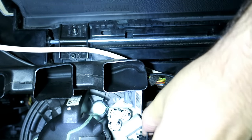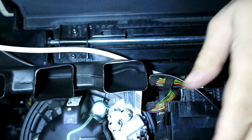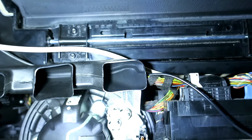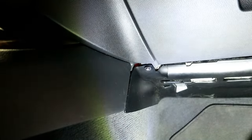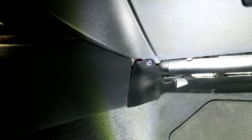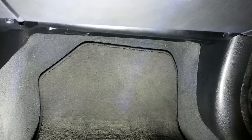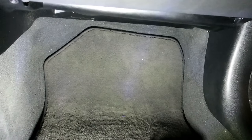That's it — reinstall the power connector and reinstall the cover underneath here. That's pretty much it. Normally you guys wouldn't have the screen mirroring hardware, but that's the easy way to remove your blower motor, change out your blower motor resistor if necessary, and lube the fan if needed.